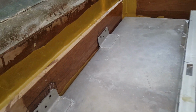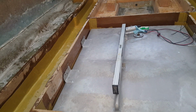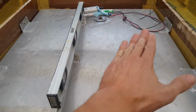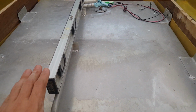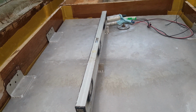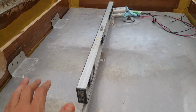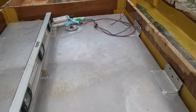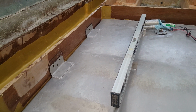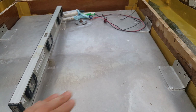The other thing I want you all to consider is this section of the boat right here under the fuel cell has 1/2 inch plywood going over top of it, and there's nothing to keep it from bowing underneath. There really isn't, if you think about it. So what that's going to do over time is it's going to create a U in your plywood, because this is a common area for everyone to walk around in the boat. I think this is part of the design that I don't really agree with at all when it comes to putting a fuel cell directly in the middle, but it makes sense. You think you got 20 gallons of fuel, where else better to put it than in the middle of the boat? So it kind of makes sense in some ways, but I think what you need to consider as well is we need to have some sort of brace to go across it.